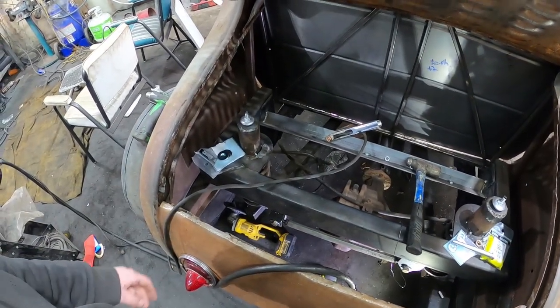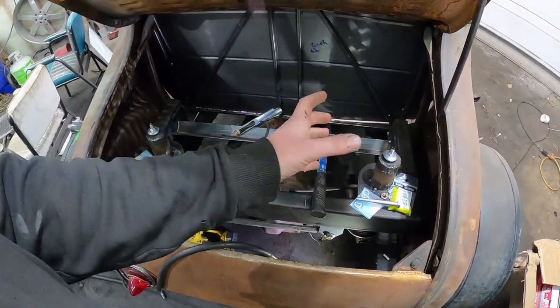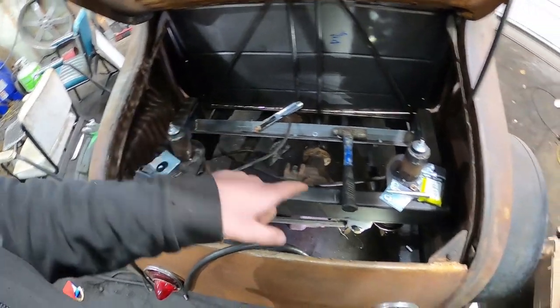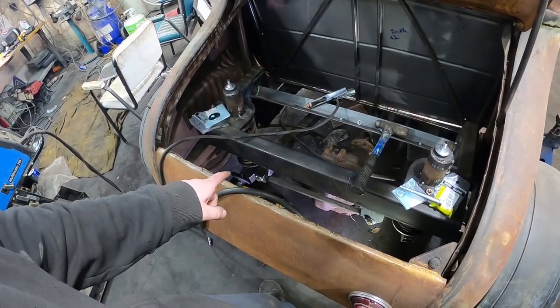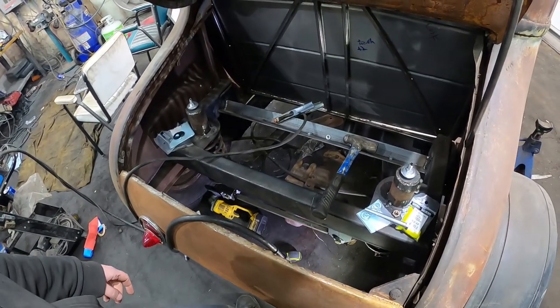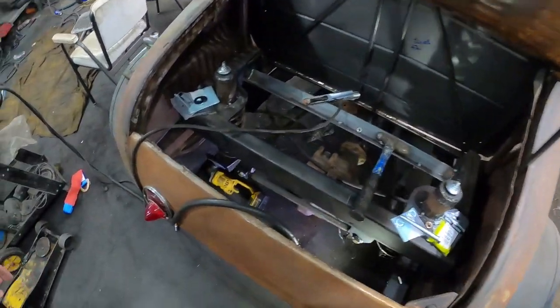So, set up the welder. Just gonna burn the shock towers, whatever you want to call them, in proper. Weld this bracket to the diff and to the back of the frame solid. Then I'll hammer those so they're nice and tight. I got to just snug up the adjusters on the panhard bar. Then I'm calling it for this episode. I need a win. It's been a battle.